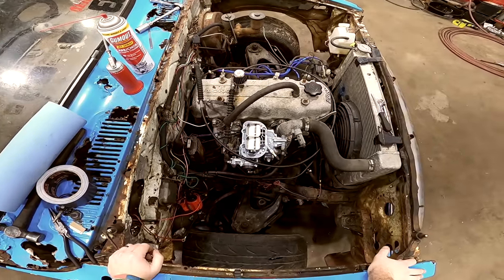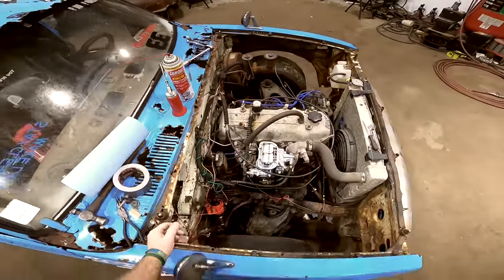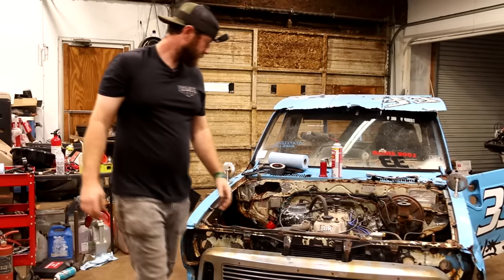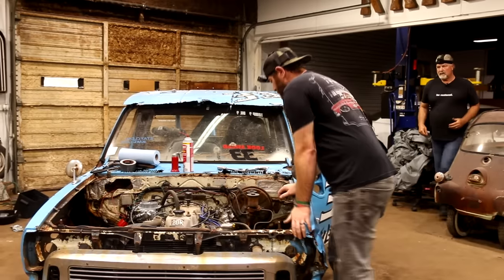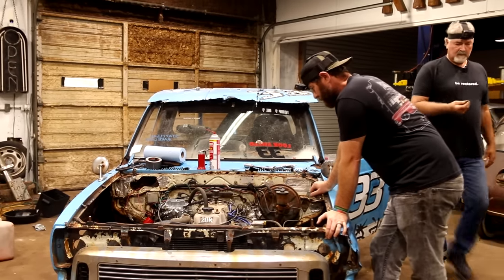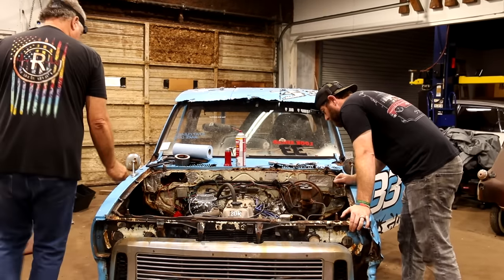We can start pulling the plug wires off as it's running to see which cylinder it might be. Right. May have been that plug that broke. Right back one. Could be that plug that we put in it, yep. Yeah.